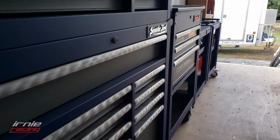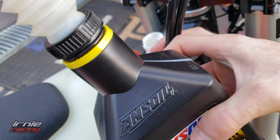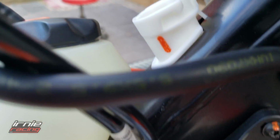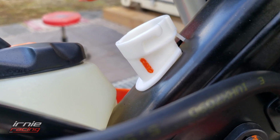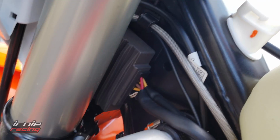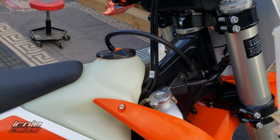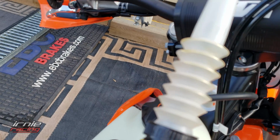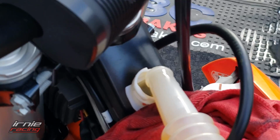Okay guys, right away I noticed the problem. Besides having to pull these cables back out of the way, is dirt. The cap seals at the top, but the dirt's gonna build up all along there. There's a few little rocks and pebbles that I cleaned out. Putting a sock along the bottom will do wonders, because the cap just locks on the top, so you're gonna get dirt in there by accident if you can't keep the area clean. Okay, problem number 2. I go to pour in there and it backfires and comes back because the hole is big, but then it goes to a smaller inlet. So then it just splashes back. So you definitely need a towel or something.